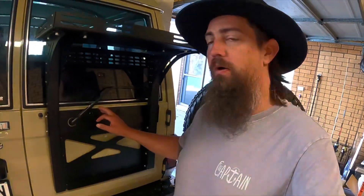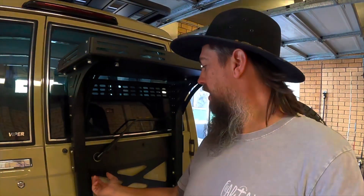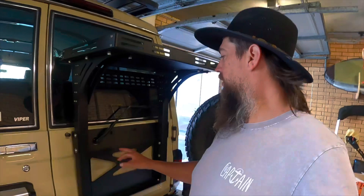Hey guys, it's a few days later. I've got that rack fitted up now and I made a few changes. I spoke to Sean and wound up getting some bolts — not actually longer, but the standard Toyota ones had the thread tape off a little bit, making it hard to grab the thread inside the back of the door. The bolts I got had a 10 mil by 1.25 straight thread, so they grab that thread a bit easier through the quite thick adhesion foam behind the back.